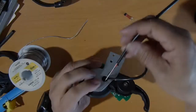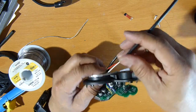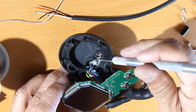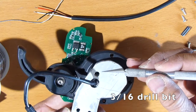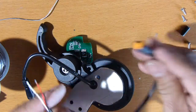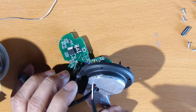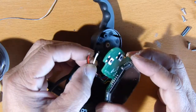That's what it looks like. The first thing you're going to need to do is drill that hole to get this cable in here. Once it's in here, I can solder it onto the three pins. The hole is drilled right there — that's where we'll insert the pigtail inside here. There it is, and now we can solder it on.